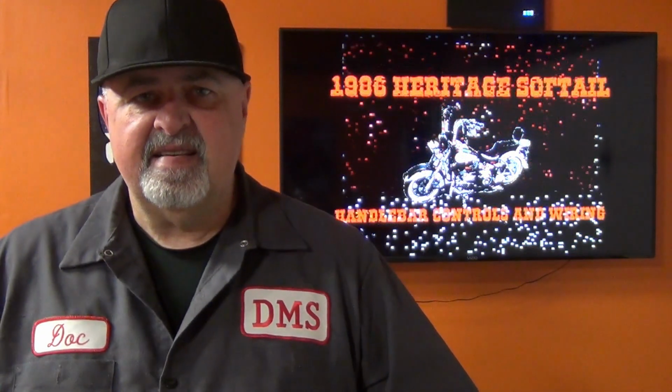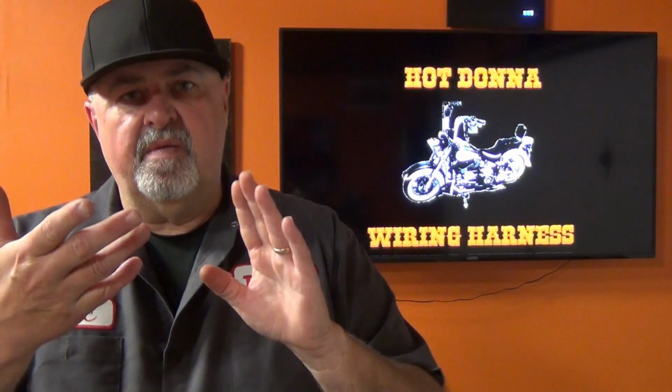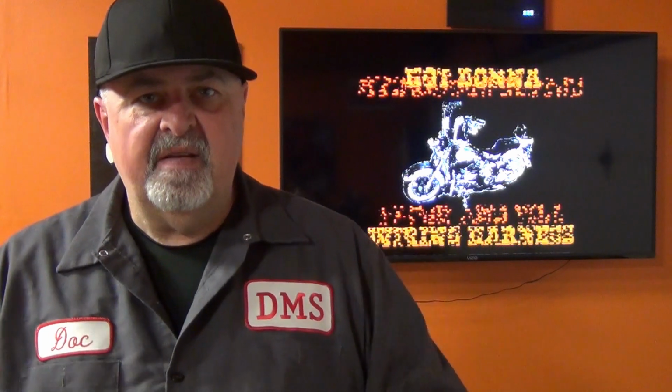So I started investigating the wheels. We determined that the rims were 16 by 300. And what that basically means is that front to back, it's a 16-inch rim, the outside part. The 300 classifies its width, which makes it take a 3-inch wide tire.